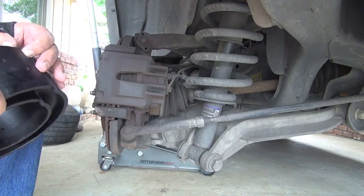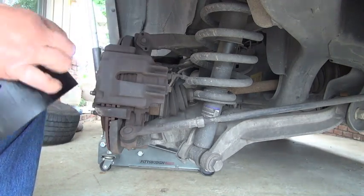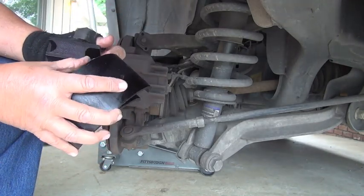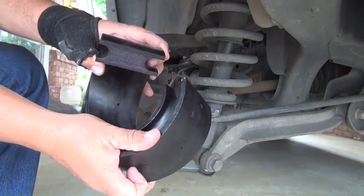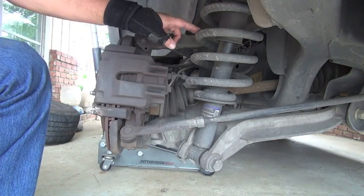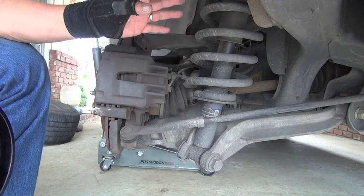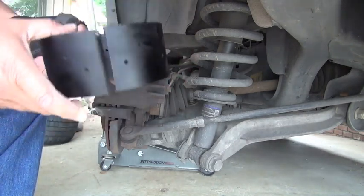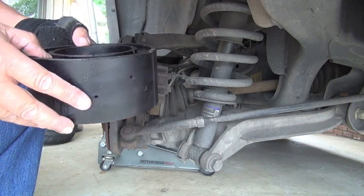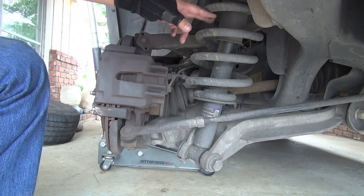After two hours of trying their method on the other side, I finally gave up and decided to figure out why these springs weren't going on. When you look at the inside of this spring, you have two channels — a deep channel and a shallow channel. The shallow channel goes on the top, the deep one on the bottom. The surface in the middle is the exact distance between these coils when extended, meaning very little to no room to play with, which makes this the most difficult thing I've ever done — and I've been working on cars for 40 years.